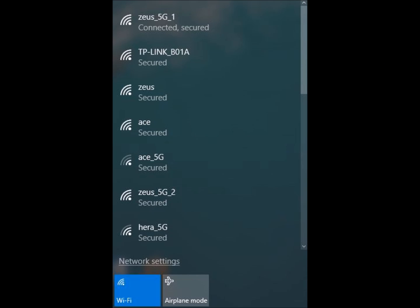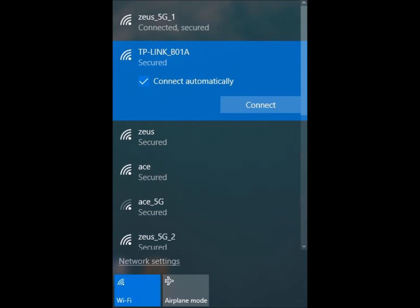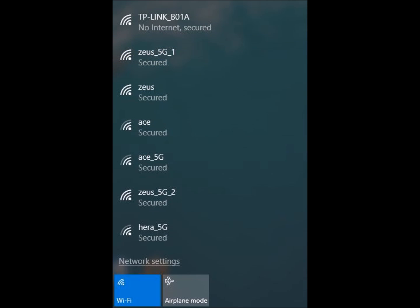Multi-SSID simultaneously supports up to 4 separate SSIDs and VLANs in AP mode. It partitions an existing Wi-Fi network so different users, admin, parents, children, guests, can have different access levels. For many users, the AP500 will probably serve as a range extender.